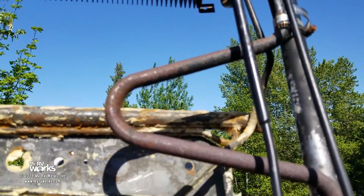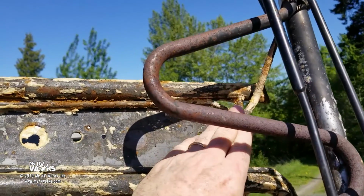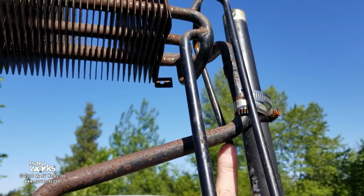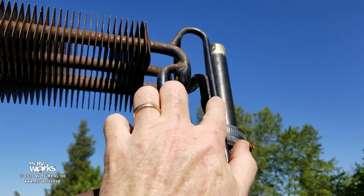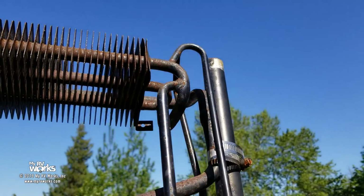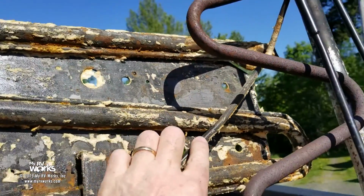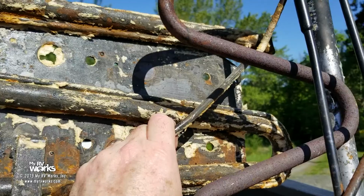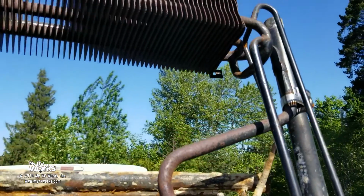I'm going to switch hands and go this way. So now we are in this tube. Okay, do you see up there where they joined? The hydrogen coming in from this guy, and this is being a gas, and the ammonia coming in through this. So now we have everything in this tube. So at this part of our story, the ammonia has gone from a liquid in the water. It vaporized out. It became a vapor.